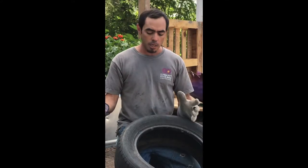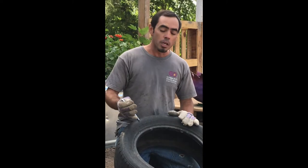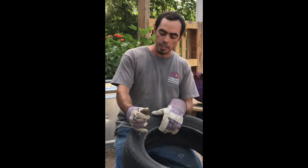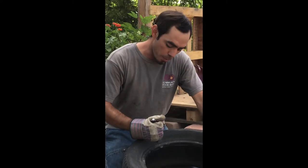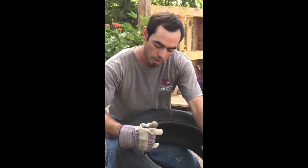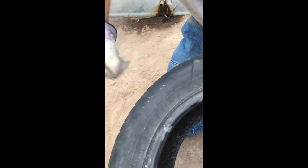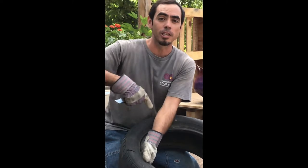Once we have the knife in our hands and we decide that we're gonna start cutting, it is really important that every time you do a cut, you have the knife pointing away from you. This is extremely important because there are a lot of incidents that happen when people do this and eventually the knife slips away and you can get yourself cut really easy. So we start from the top, make our cut, and then stop right there. Then for the next cut, we rotate the tire so that we position ourselves so the knife goes away from us. Here we have made our first cut and we just have to keep doing this all along the side of the tire.